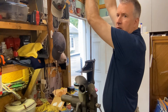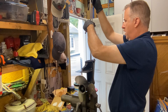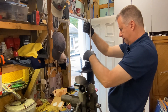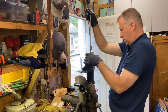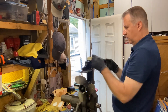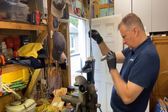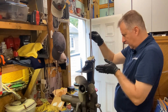I'm going to go ahead and take this back up. I got a little oil on the surface that I cleaned just doing that, so I'm going to go ahead and clean that off again with my brake cleaner. I want to make sure I get a good seal. At least now I know what that feels like when it goes down inside there. It'll be a little tricky, and it'll probably be a little tricky getting that clip back on too. So we have to tilt this to get the pickup tube in. The clip goes down there.